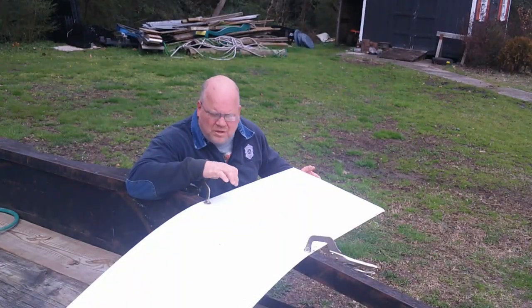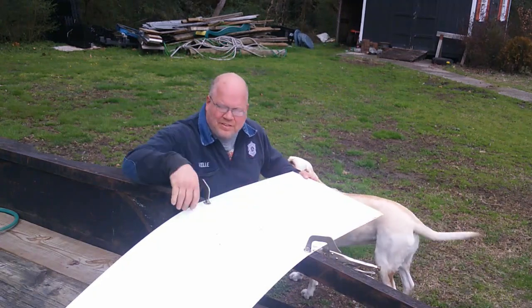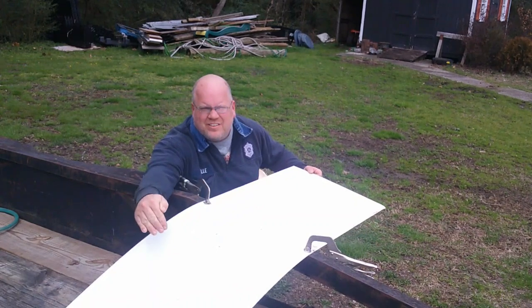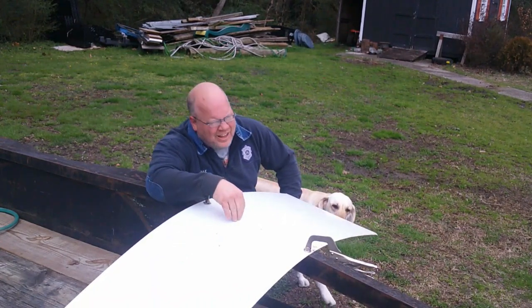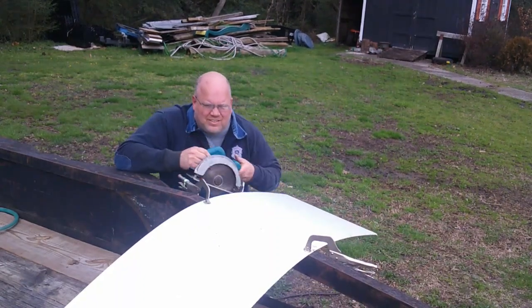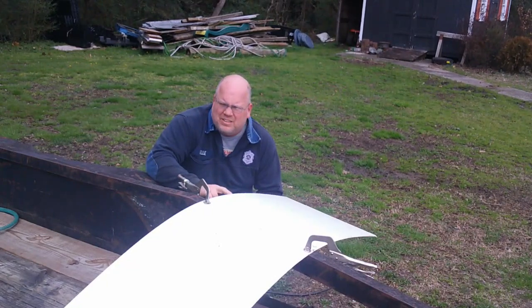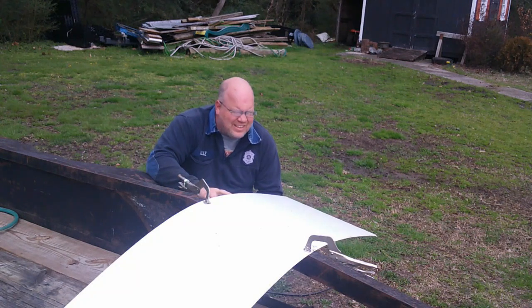Alright, so I got my aluminum marked. Going to cut a 22-inch piece off here. And then this is 20 inches wide. I'm going to take the remaining half and rip it 10 inches this way. That will do my driver's side floorboard and half of the passenger's. And to cut it, I'm actually going to use a skill saw. Every time I've cut this kind of stuff in the past, I've used a jigsaw, but it means I got rip cuts and all kinds of stuff to do. I want to try to keep it straight and fast.